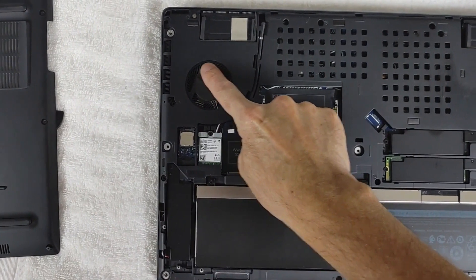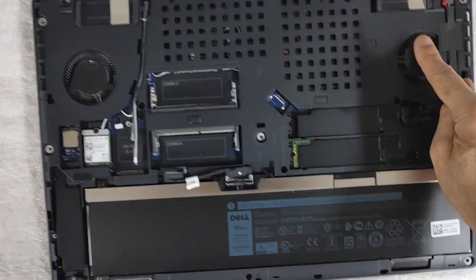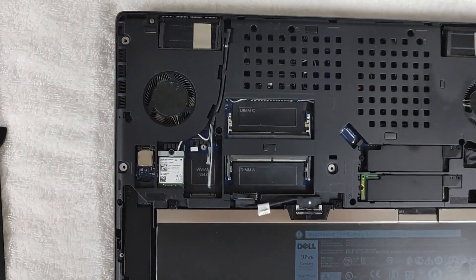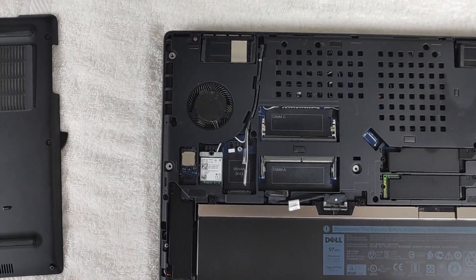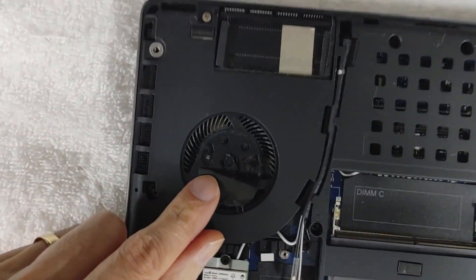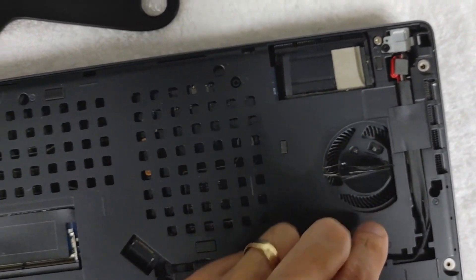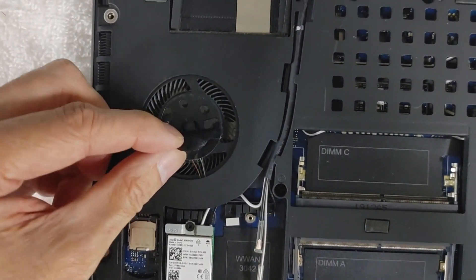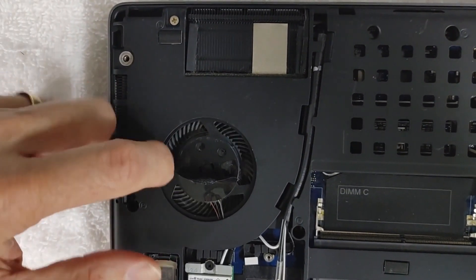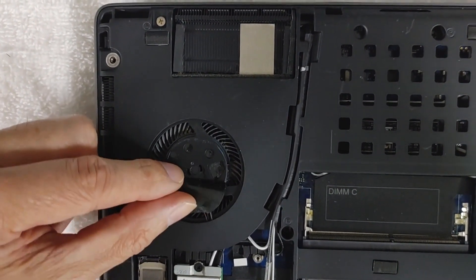It's kind of scary. Down here are the cooling fans — one right there, one right there. What I'm wanting to do is pull these labels up right here and access the motors. I was able to get the labels peeled back on the cooling fan motors. One thing to note about cooling fans in computers: usually whichever side the label is on, you can gain access to the motor shaft.